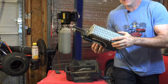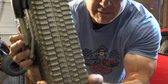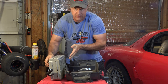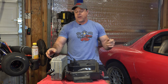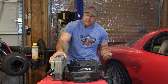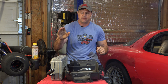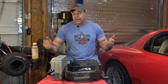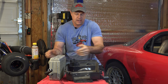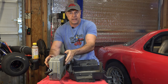But you look at this thing right here — it's in really, really good nick. I can't see any damage. I thought it was new because when I had my engine build, I also had him convert it over to 134, and I thought maybe he replaced the evaporator core because when I took this out it looked so good. This is the Denso unit and that's one of the better ones. But I looked at my invoices and I didn't see any replacement for an evaporator core. I'm shocked at how good a shape this thing is in. There's no evidence on the bottom of the casing of any leak from this evaporator. So I'm keeping the evaporator — bottom line.